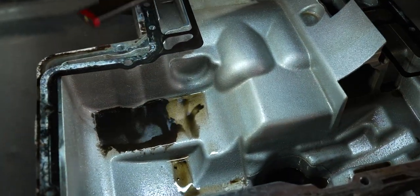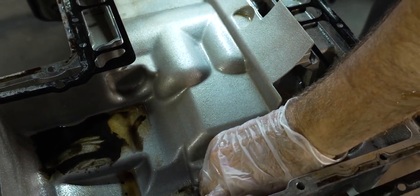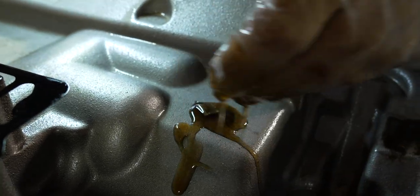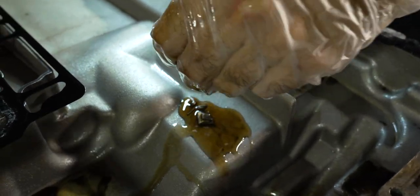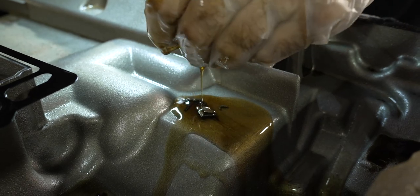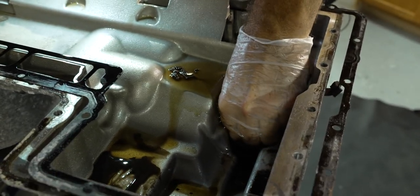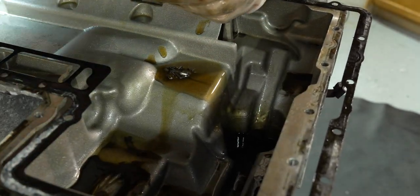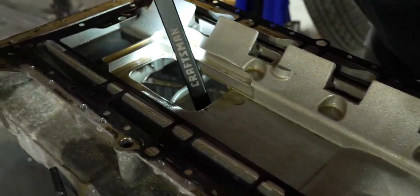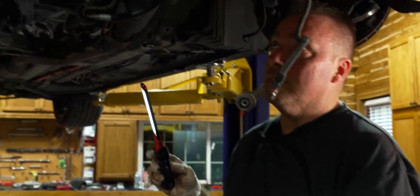Looking in the oil pan - it's a little bit sludgy. I think that's a vanos pump issue. What I see looks like teeth and a piece of the race - just like the last blue car we did where the vanos pump was blown out and had lost some teeth. There's nothing in the rear part of the pan at all - it's all contained to the front partition, which is a very good thing. That spring is going to be out of the pump. Let's get the vanos pump off next.